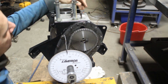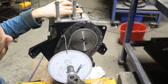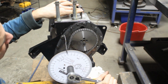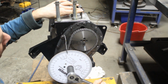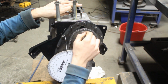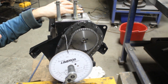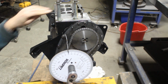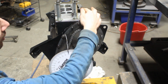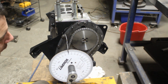And I'm gonna put my fingers on top of the two pushrods and start turning to see. Now I see my exhaust starts to open. So I know that a little bit before it closes again, it's gonna be my overlap time. Yeah, and now I feel with my other finger that the intake starts to open too. So I'm gonna bring it somewhere here, is my top dead center of the camshaft. I know that I am in the overlap area, somewhere within it, I don't know where exactly, but we're gonna find that.